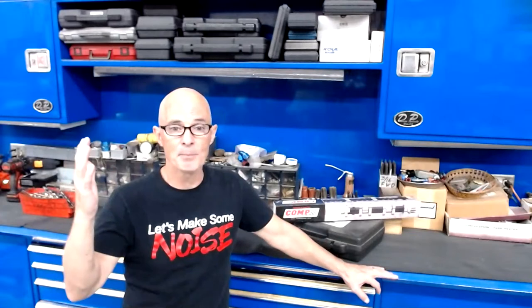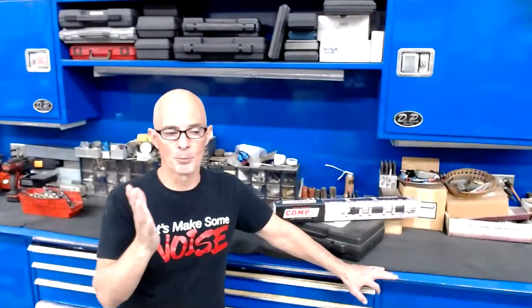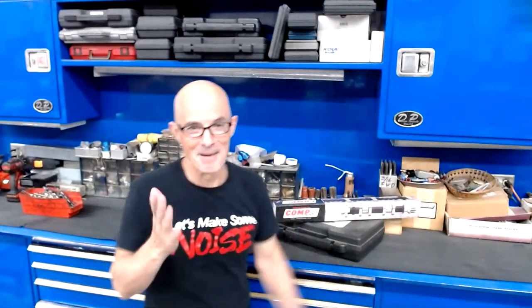So I think it's the intake valve closing. What they're looking at is when you put a wilder camshaft in, you're bleeding off some of that cylinder pressure. We're going to talk about why that might not be happening and how important that is. But the thinking is that when you have high static compression and run wilder cam timing, it bleeds off some of that, and then you have a lower effective dynamic compression, and then you can run that on a lower octane fuel, which is absolutely true, at whatever the detonation threshold is, if you can understand and measure that.